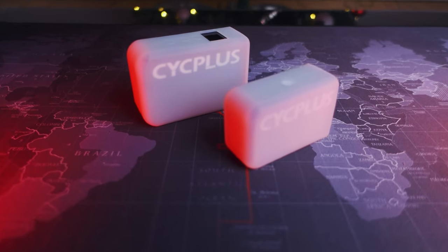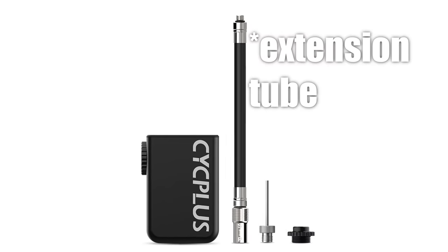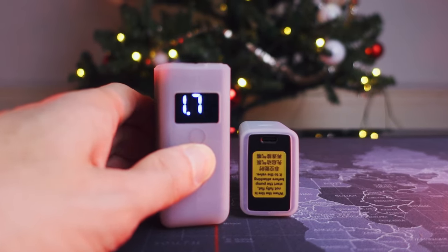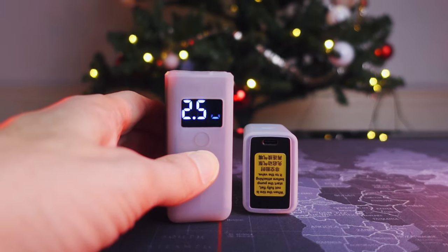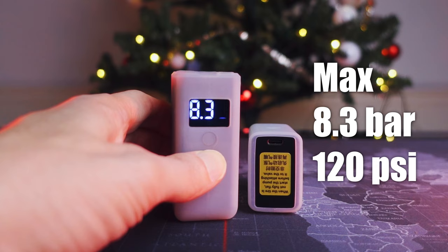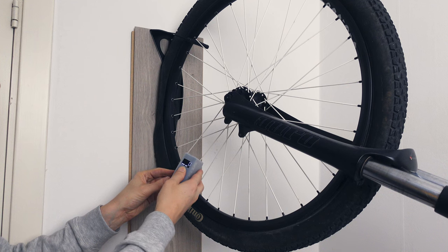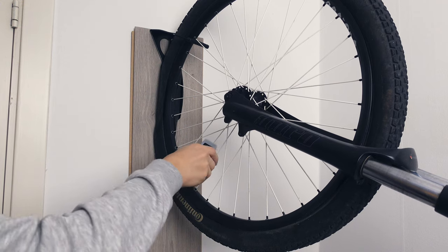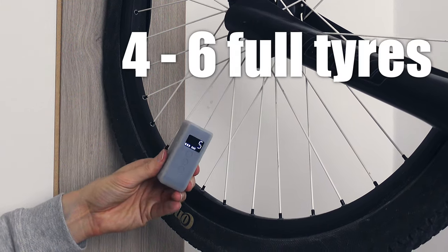The larger Pro Max was delivered with a hose which you can use or not — it's not necessary in my opinion, but can be handy if there's little room. The hose can be bought separately for the smaller AS2 pump. The target pressure can be set on the Pro and Pro Max, and the pump will automatically stop when the target pressure is reached. The biggest benefit is the display showing tire pressure in real time, which is very useful for mountain bikers tuning pressure out in the woods. The battery is twice the capacity of the smaller pump, so let's say four to six uses.